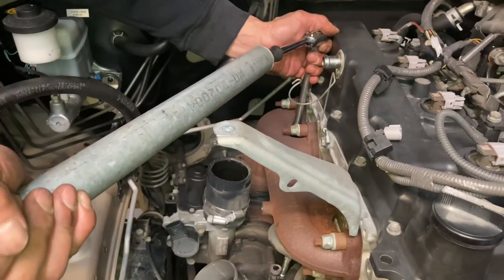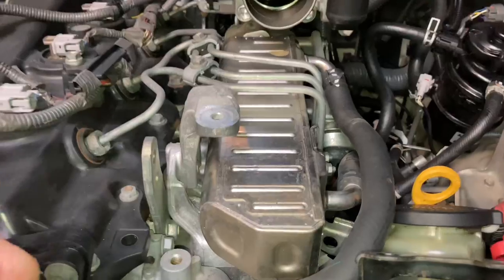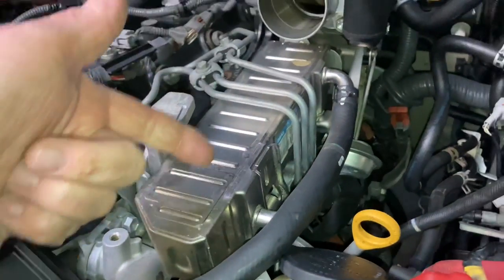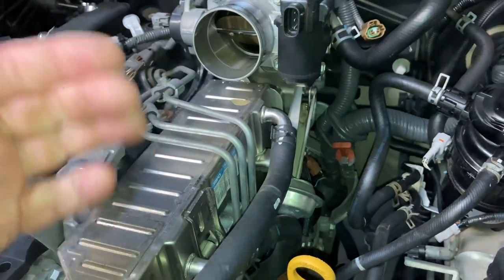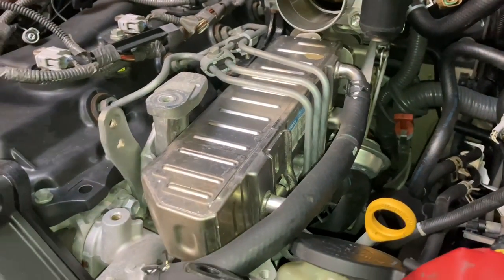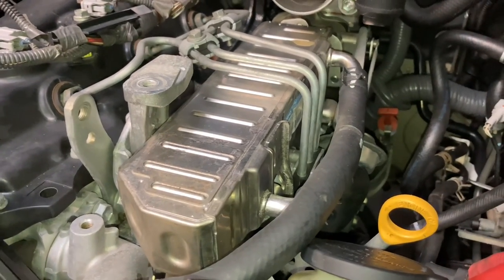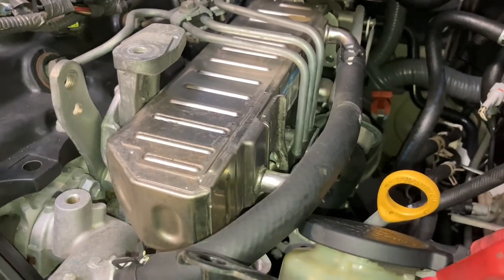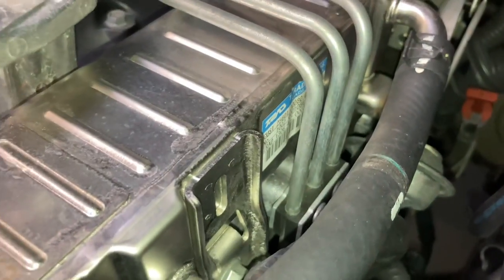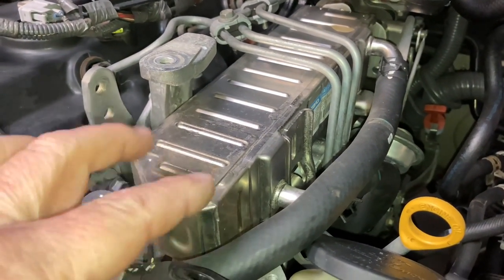Back to the EGR cooler — that's really important. How are you going to know if you've got an internal leak? When I say internal leak, you've got coolant running through here to cool down the hot exhaust gases that come out here to go back into your intake system and mix with the clean, filtered, cool air from the intercooler. Sounds like a pretty dumb idea, doesn't it? Internally, if you've got a leak, that's where there's damage inside somehow. This is a quality stainless component made in Japan — we don't see issues with these normally. This is not from your cheaper makes and models.